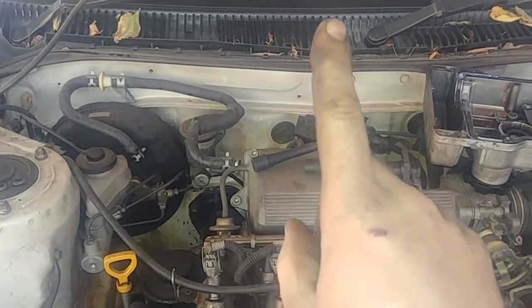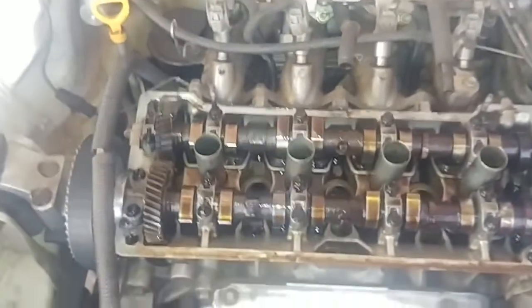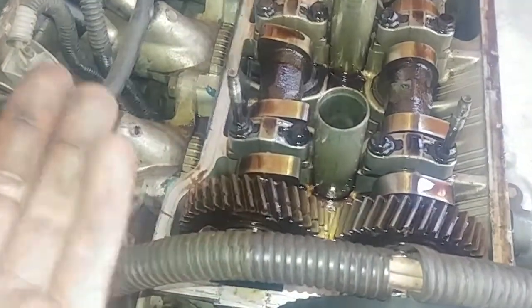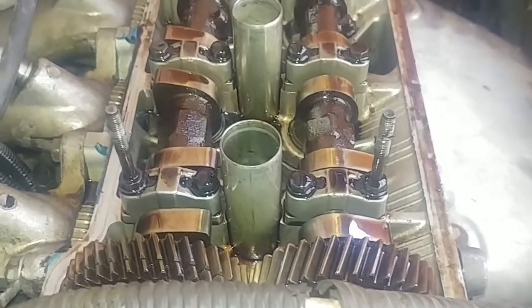Your firing and rocking positions will be at 90-degree intervals. So basically when the cylinder is firing your lobes will be in one position; when it's exhausting they'll be at the next position; then intake. On the exhaust camshaft it gets confusing, but hopefully I'll be able to work through everything. If you look at cylinder one, both lobes are pointing one way. If you had two individual camshafts these lobes would actually be pointing the opposite way, because after firing the next stroke is going to be the exhaust stroke. Once the piston fires and moves down, the cam turns, opening your exhaust valves on the upstroke cycle.